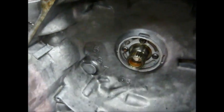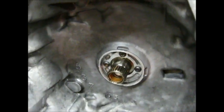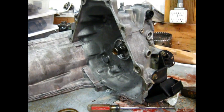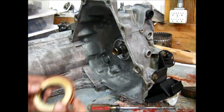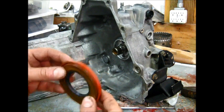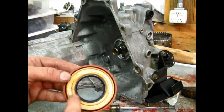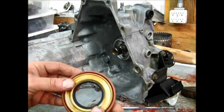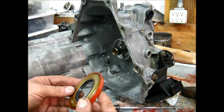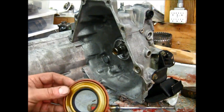I couldn't get it out with the seal puller. The new one is very thin and it only has to be driven in by this edge. If this part in here gets bent at all, it's going to leak — it's going to ride crooked and leak. So this is not something you want to do unless you really have to do it and you have the proper driver.